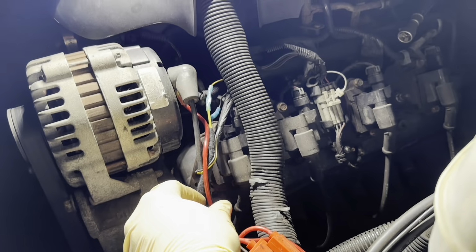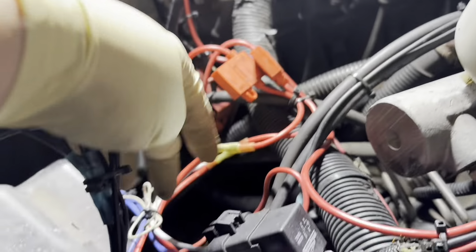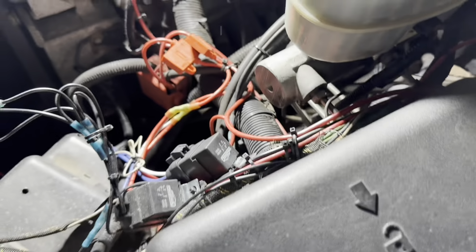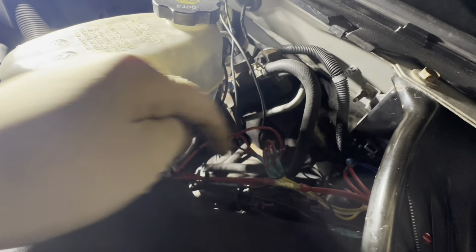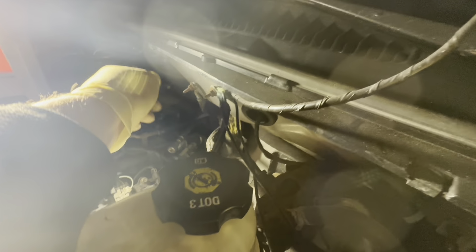Okay, so I pulled 12 volt power off the alternator. It's starting to get a little packed down there with all my other stuff. So that runs over. And everything is just tucked over here. I can make that look pretty another day. But like I said, the wire comes in, goes into the relay, comes back out the switch. Ground, I just ran back over to here. We have a couple grounds going, a couple grounds up here. It don't matter, there's a lot of accessories on this truck. And constant power is off the alternator. Super simple, let's wire it in.